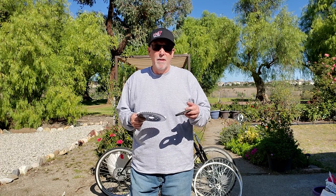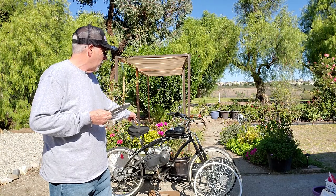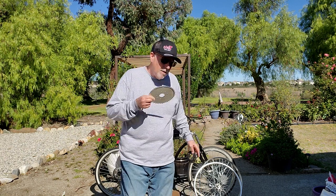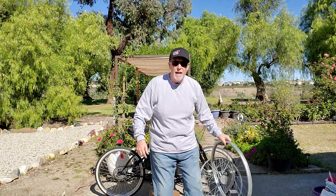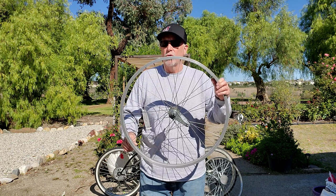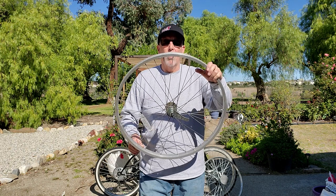I'm happy with it. I have a little 80cc bike here — a bit underpowered for the weight of the bike and more importantly the weight of the rider — but it goes pretty good with the 40-tooth sprocket on the back. But forget about the gearing for a minute. The more important thing I want to talk about is the spokes. The standard wheel that came with this motorized bike is made for pedaling at maybe two or five miles an hour, and it has 14-gauge spokes.